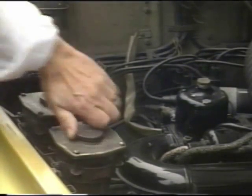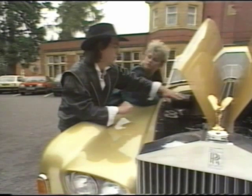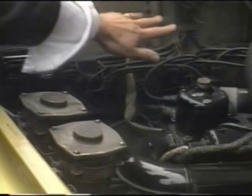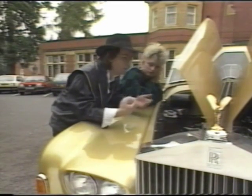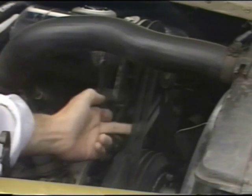There are twin carburetors which need topping up with fluid on top, and a distributor cap like any other car — which has eight outlets that you need to sometimes clean. The beauty of this car is where Rolls-Royce think of things like how to stop breakdowns — they've twinned up on fan belts and points.